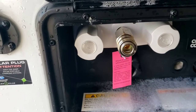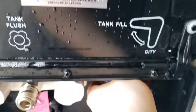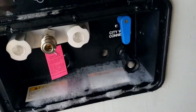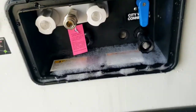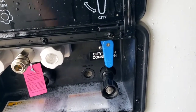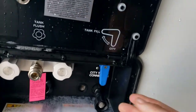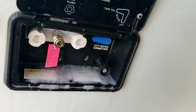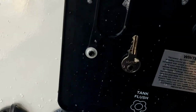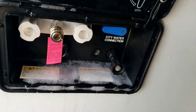External shower — a quick disconnect. City water connection is where you screw your hose in. If you're going to fill your tank, put it the other way and you'll pressurize your tank. Monitor its progress on the monitoring panel — please do that. This is your tank vent; water will start squirting out when your tank is full. Since it's being filled via pressure, you definitely want to monitor its progress. Don't walk away because you'll start pressurizing the fresh tank and could burst it. When you fill the tank, go inside, watch the monitoring panel, and as soon as it says full, come out and turn your hose off. They also give you a backup key, and these little slots work just like the cable inlet, so you can keep the drawer closed and still have your hoses in there.